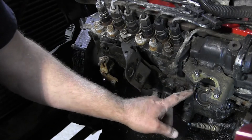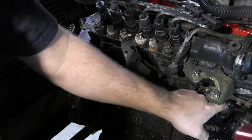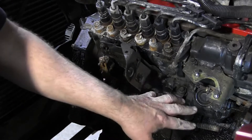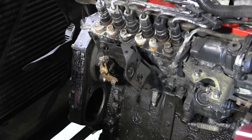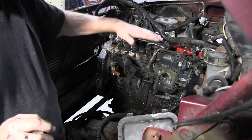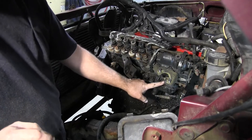There's a little keyway on the fuel shutoff shaft that sometimes is loose — in our case it was really tight so we left it. There'll be a safety wire on most of these covering the governor plug and you have to cut that wire out of the way. Once you've done that you can see the governor plug on the inside of your injection pump. You can see the whole engine here — the lines, AFC, and brake stuff all moved clear.